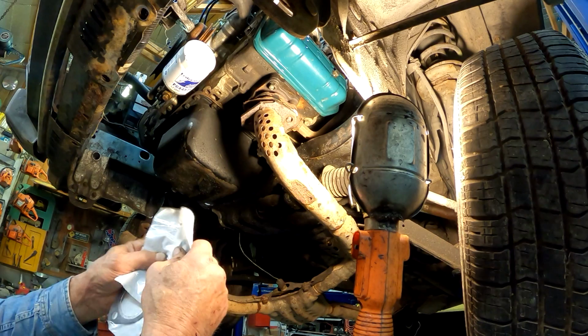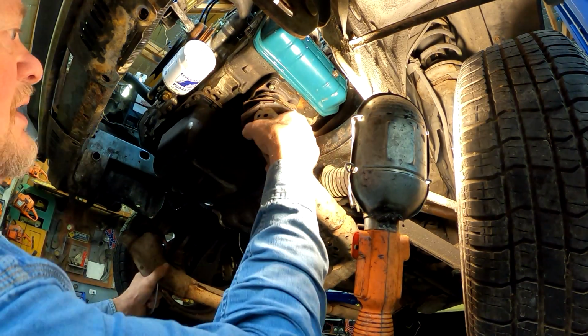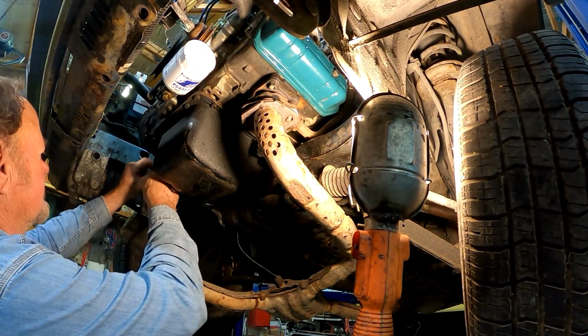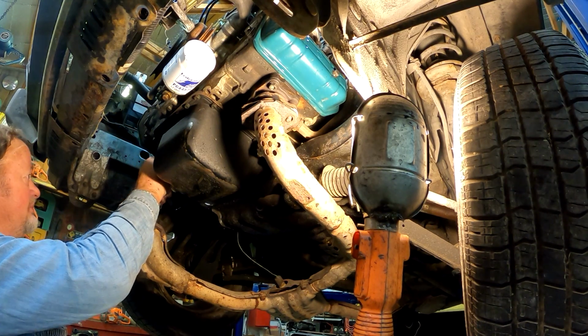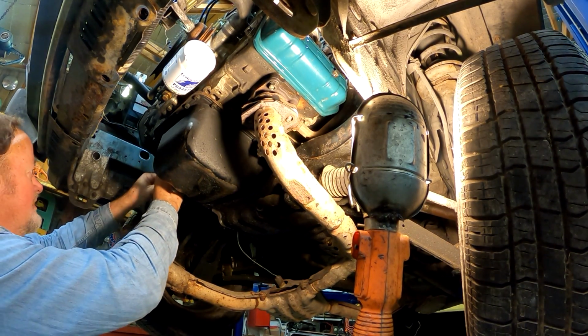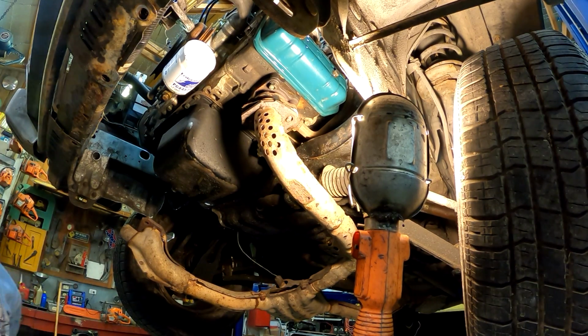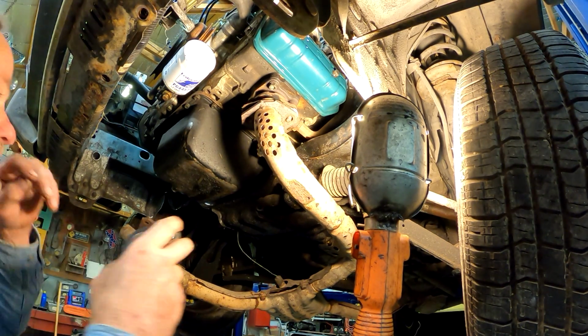Well, maybe I can get y'all up to speed a little bit here. We've been working on this thing quite a bit. I haven't filmed a lot, but I actually got quite a bit done. This thing, brakes were not good, non-existent actually, and was trying to diagnose that, and Warren came up and helped us, and we're flushing out brake lines, and we had Noah up in there bumping the brake and this and that, but we finally narrowed down to a bad master cylinder. So we swapped that out, and that little parts car over there, it's already paid for itself, you know, with the little goodies we keep taking off of it. We're going to be taking a whole lot more of it too.